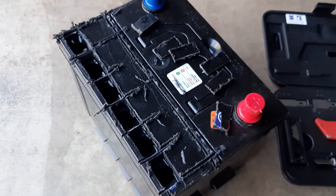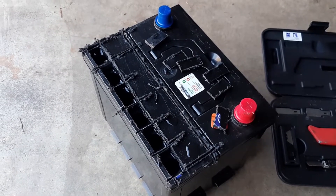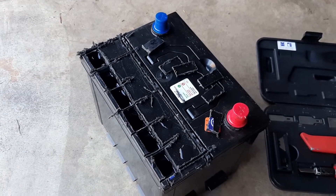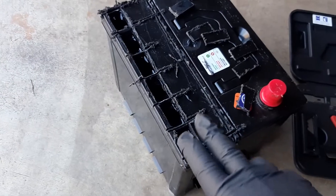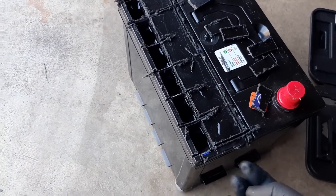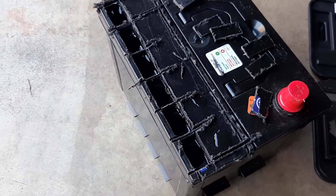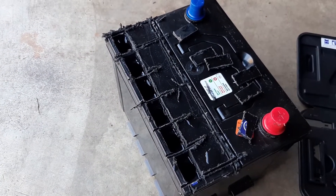The reason I'm using the black glue sticks is they match the color, and the lighter the color of the glue stick the softer it is - so the black one is the hardest one. It'll also match the case. I had to peel the sticker off to see if we could flip it up with a screwdriver, but you can't because it's all sealed - the only way to open it is with the cutting wheel.